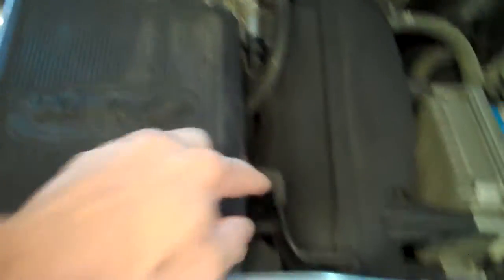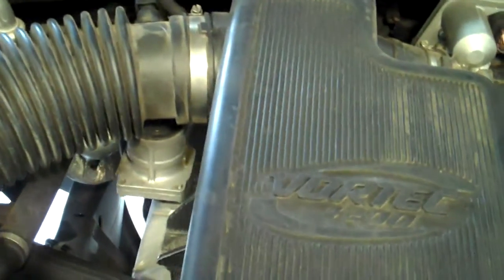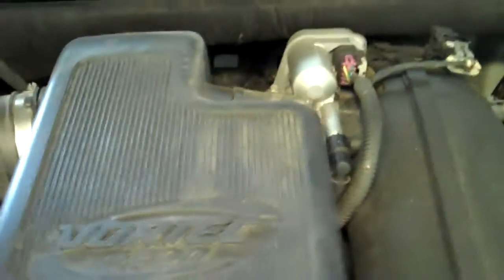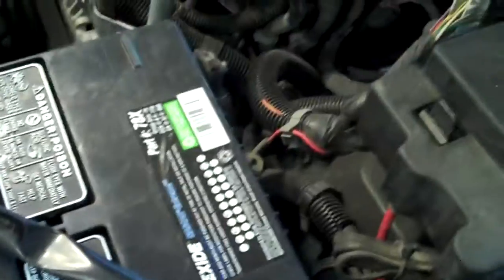What we're going to do is take off the top cover, undo a couple of hoses, take off a little plastic flap to get it out of the way, then pull out six coil packs and six plugs and replace them — should be about a half-hour job. First, shop-vac all the debris from around this motor because Murphy will let that fall down a spark plug hole after you've removed the plug.